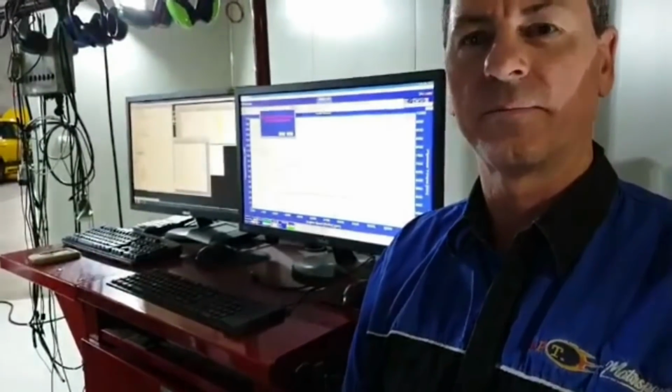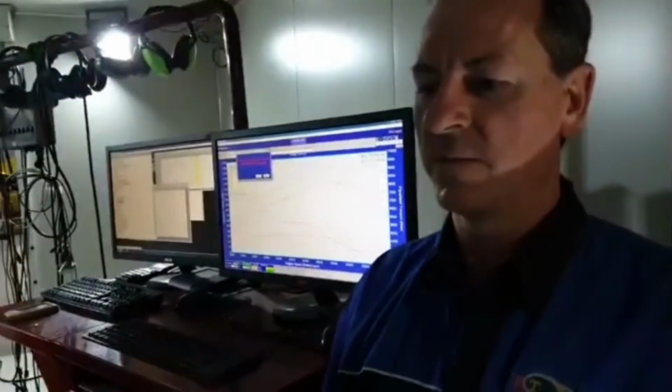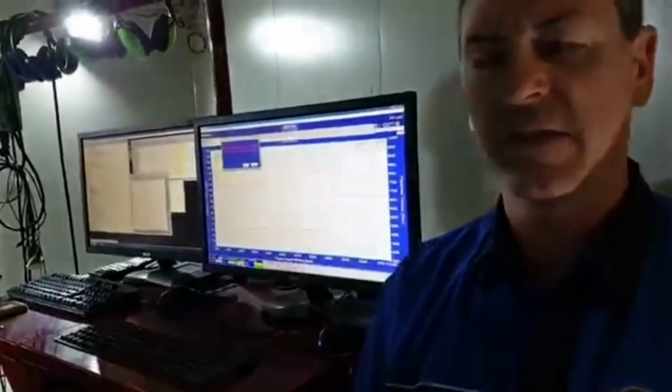Is the tune limited to standard auto, or does it work in sports mode too? Okay, so another good question. With the calibration on the trans, we change around about 98 parameters, whereas traditionally a lot of guys tuning the ZF box probably only do about 12 at the very most. So yes, we do it in sports mode. We do oncoming clutch pressures and so on. There's a lot in it. I could rattle off details for the rest of the night, but I'm not going to. So to answer your question, the shift time is reduced, the slippage is reduced, and overall it just makes the box feel so nice and tight.